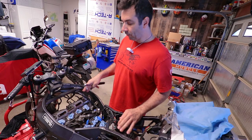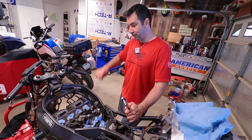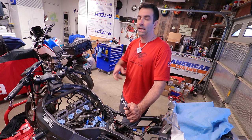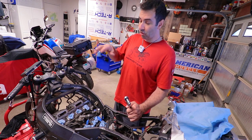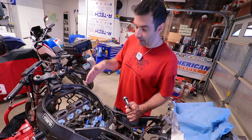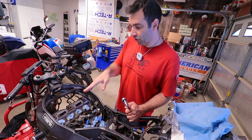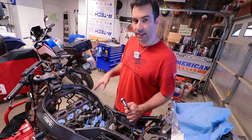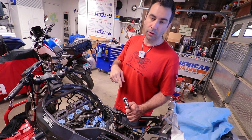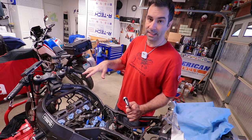Once you've tightened all of them, go back to the crankshaft and rotate the crankshaft 3 or 4 times. Let it rotate, let it move, so that those shims settle down properly, and then start again with checking the valve clearance in the same pattern as we did to check it before replacing the shims.